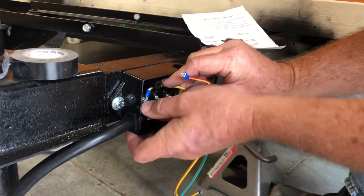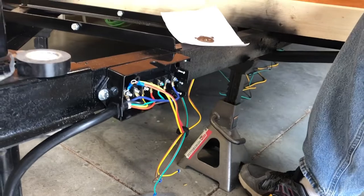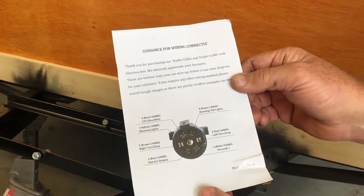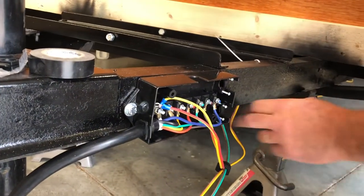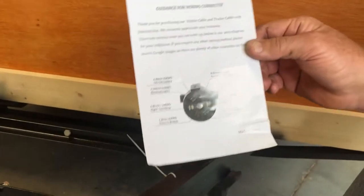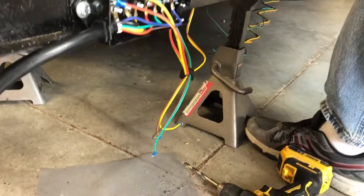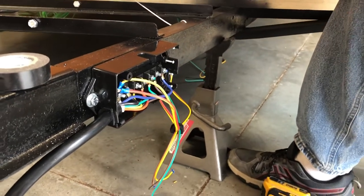The trailer brakes are non-polarity, so you can actually have them wired either way because it's just a magnet — it'll work both ways. They'll send you this little piece of paper right here and explain the colors. The colors coming back in the seven pin are not necessarily the colors going back on the trailer, so always double check everything. I use test lights to see what lead does what. There are several different seven-pin connections out on the internet — some of them are for heavy trucks and different things — so always double check that they're correct before you wire these up.